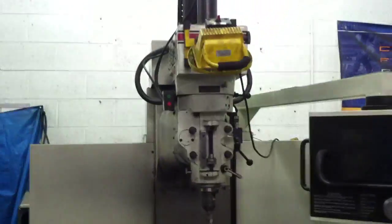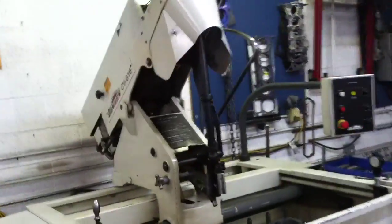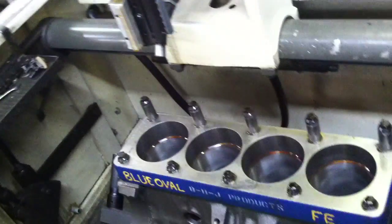What other kinds of equipment do you have? What is this machine here? That's the Rottler — it's a milling machine. I remember that you plug in all the stuff here in the computer. It does decking, boring, and that one over there does the honing. So that one only does honing? Yep. You can see these cylinders are honed almost to final size — he has to touch it in the morning. You let everything cool off just before you do the last hone. And that happened to be a torque plate on it, which we don't have for an SHO block, but you can do it without.